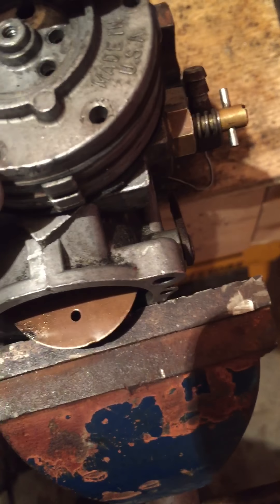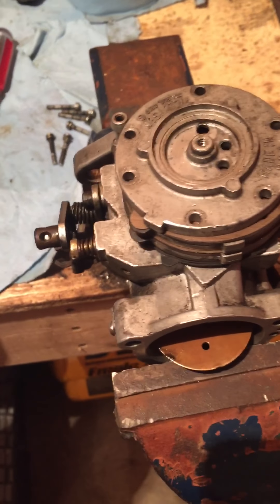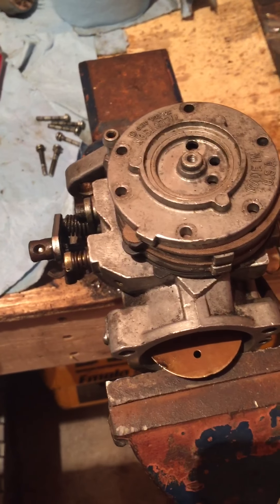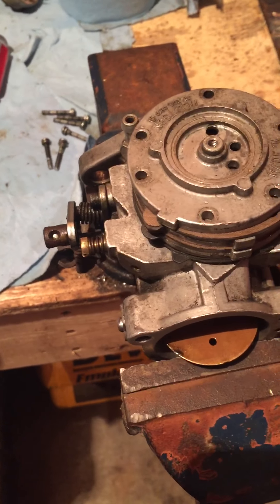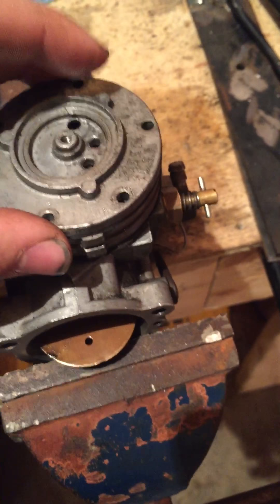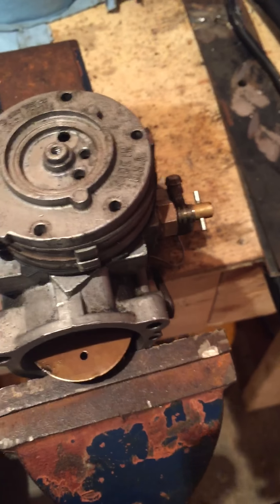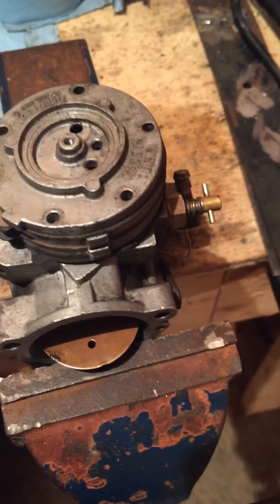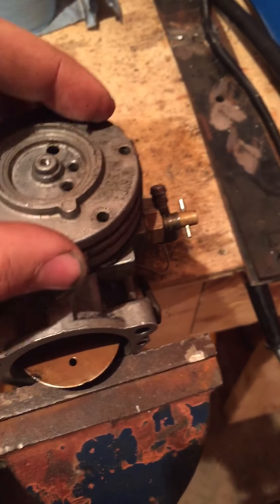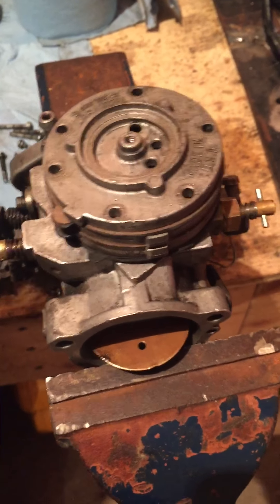I recommend replacing the fuel filters. A trick with them: if you take them where the gas line hooks up and you can blow through them with no effort or struggle, then it's good and you can put it back on. As I find running these old sleds, these fuel filters come loose over time, so I just make sure they're always tight because then they'll start leaking gas and you'll lose the gas down - you'll see the gas line after you stop using it, you'll see it run back to the tank.